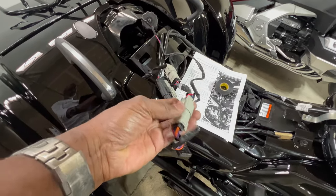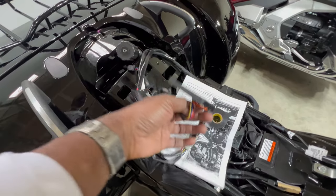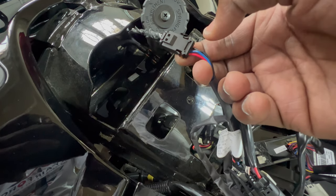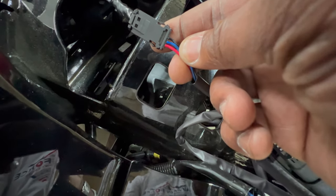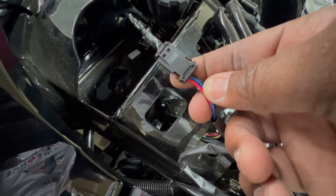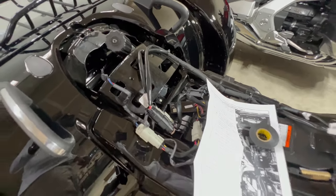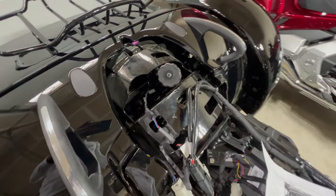Those plug in just like that and you'll hear the audible click. When you're plugging this in and mating it up, you'll see this has black, blue, and red — so you want to do black to black, red to red, and then the yellow goes to blue, because that's the only one remaining, and it says that in the directions. Now in order to start up, I'm going to plug the fuse back in, check that everything's correct, make it all neat, and put the seat back on.